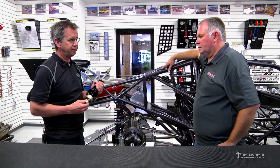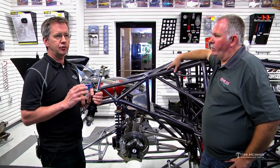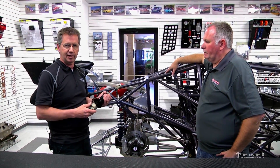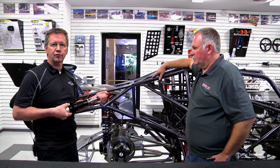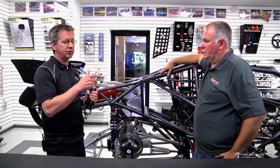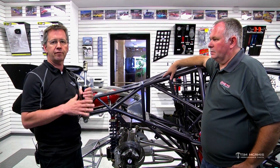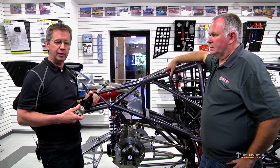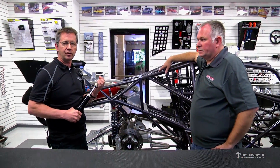We'll get into some of the triple adjustable stuff and show some of that a little later. This is a basic double adjustable that's kind of simple to understand, but once you learn it and know the terminology, you'll be a lot more comfortable tuning the shock. You'll be more comfortable knowing what you're buying — not just buying it because Joe bought a set and his car runs better. You should know what you're buying and understand how it works just like any other part of the car. We're going to extend this series and get into some more advanced stuff — triple adjustable, and also strut settings. On the opposite end of the car, we've got the same type of system controlling the attitude of the front wheel and tire. So once we get a little more in-depth with the rear shocks, we'll jump up front to the struts and talk about those adjustments too. Thanks a lot guys — if you have any questions, give us a call and we'll be glad to help.